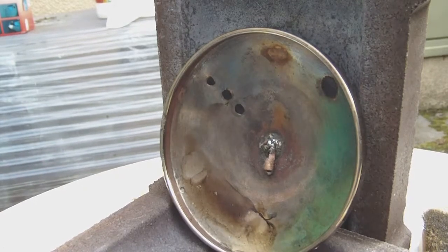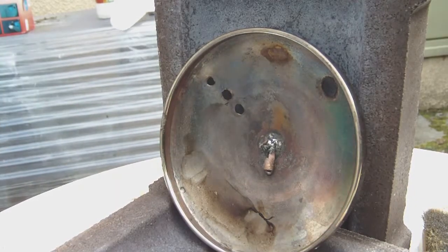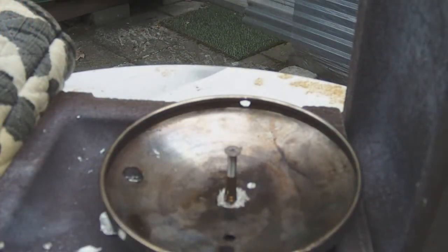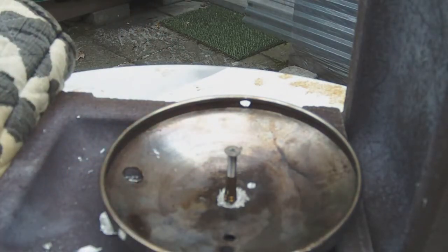We've got a problem. The first stub didn't pan out, so unfortunately it broke. So I'm going to try a second time, but this time I placed a stainless steel screw in the stub to make it retain its shape. So same method, I'm going to heat it up first, not too much, then I'm going to put some soldering paste on top of it and then solder.